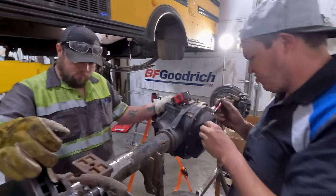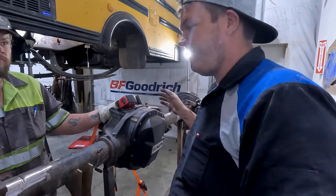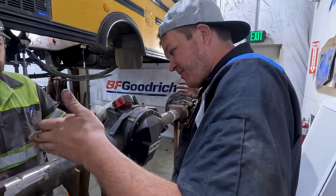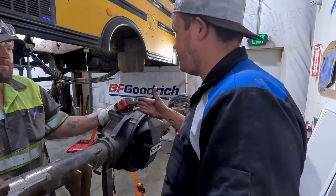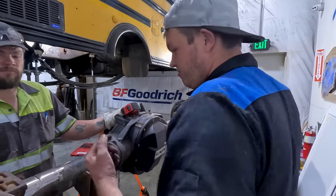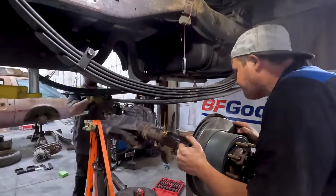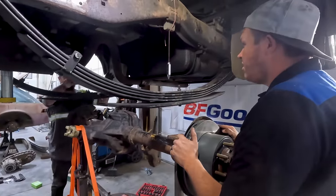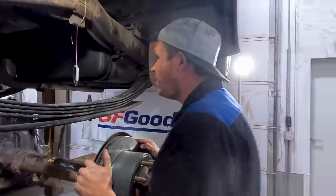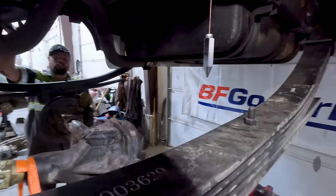Okay, we have those where they need to be. Now obviously we're gonna roll it in, set it down, get it where we need it, adjust the pinion. I think we're gonna set it at like 5 or 10 degrees, and then bolt it. And actually, once we get weight on this, it will kind of move backwards a little bit because it's solid up front, so it might be closer to center and we might not have to trim those.